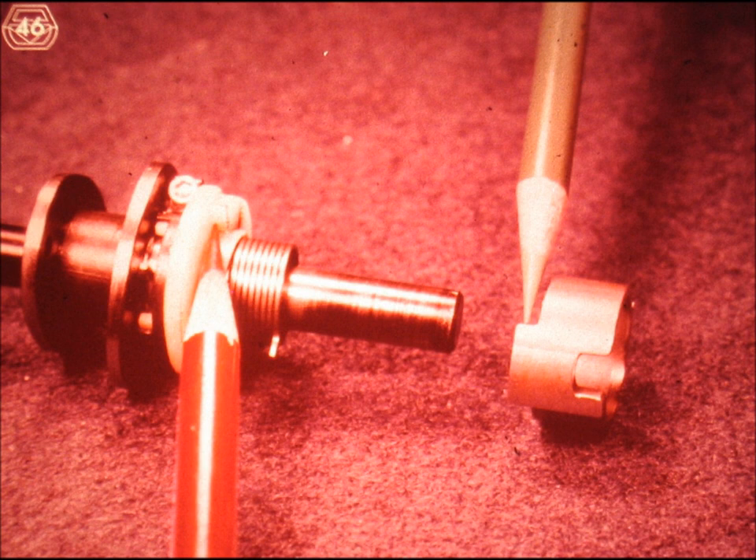When the clutch is fully assembled, the clearance between the overthrow stop on the cycle clutch restoring cam (red pencil) and the step on the cycle clutch sleeve (green pencil), when the cycle shaft is resting against the check pawl, should be approximately one quarter of a millimeter. This is achieved by the angular positioning of the cycle clutch latch restoring cam, using the cycle clutch latch as the fixed point. It is most important to mention the print clutch here, as all mechanisms having to do with printing are driven by it. Think of the cycle clutch as the printing clutch, and it will help you understand the mechanism.